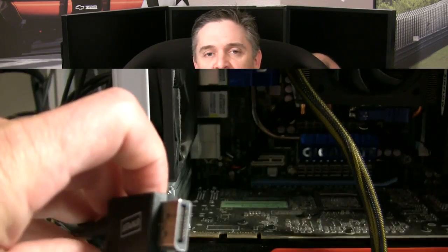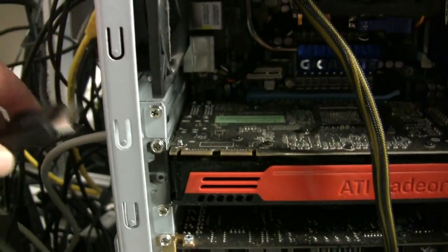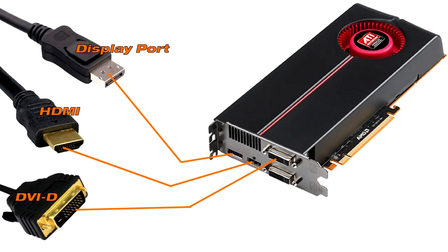Hear the fans blowing? Fans just running full blast. As you see, no displays going on in the background here. And it was just causing major problems for me. I had to unplug the DisplayPort cable, boot the system up, then plug it in as it was booting up, and then I could run triples. Well, this is the solution to that. And it's supposedly specific to this video card with these monitors. It's not happening with all 5850 cards. Shaun, thank you for turning that off.